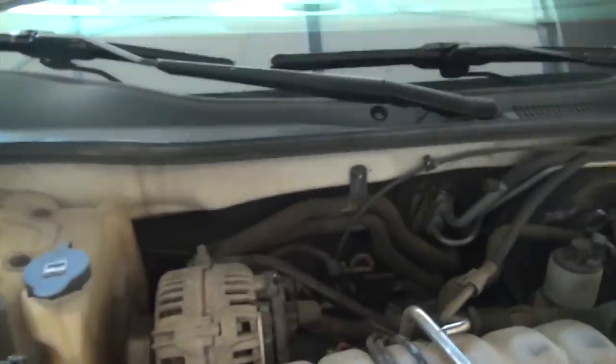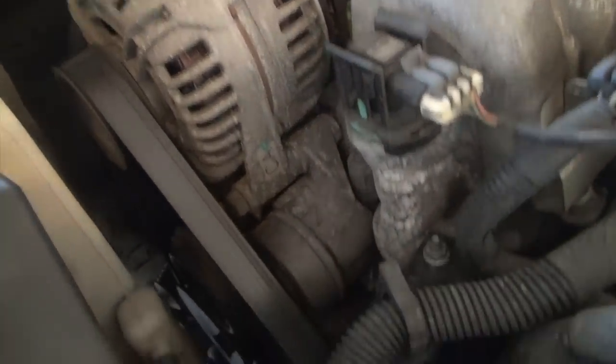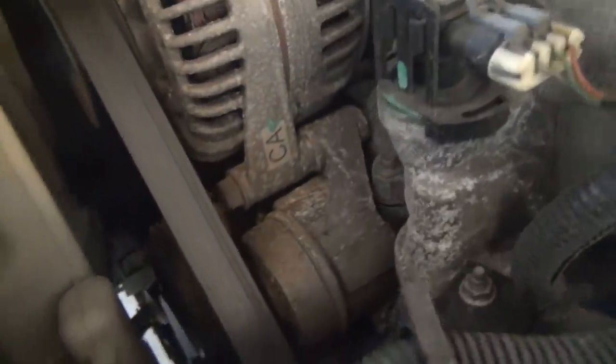It's kind of involved. It's not terribly difficult work, but it takes a bit of time. You have to remove the alternator which shares a bracket with the tensioner pulley and also has passages for the coolant to go back to the heater hoses. There's the heater hoses. You can see the alternator here and the tensioner pulley. Then just below that there is a little plastic elbow.